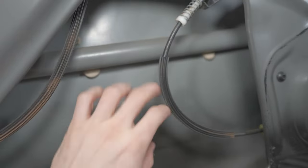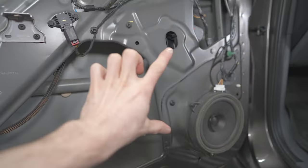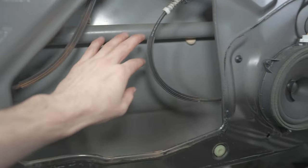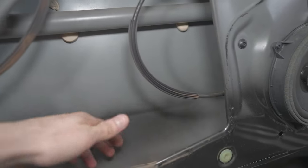It does vibrate, big flat panel. There are different braces and things in there that might make it awkward to do one cut that covers the whole thing. So you might have to do it in different sections. For the sound deadener, it doesn't matter. With the acoustic liner, the bigger the cut you can get, the better.